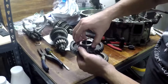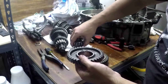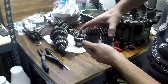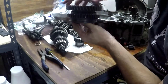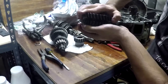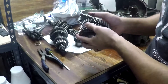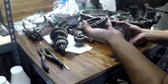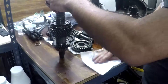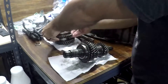We're pulling off first gear here. You can take off the bearing and take off the inner bearing retainer. We have the tapered bearing on the outside and the roller bearing on the inside. This is how the synchro works — this is the hub assembly with reverse on it. We can see that first gear spins freely, and then as we press that in, it locks into place. That's essentially how we're able to spin the shafts of the transmission together. You really want to take some time to play with your transmission while it's apart like this — it's a great time to learn how everything works.